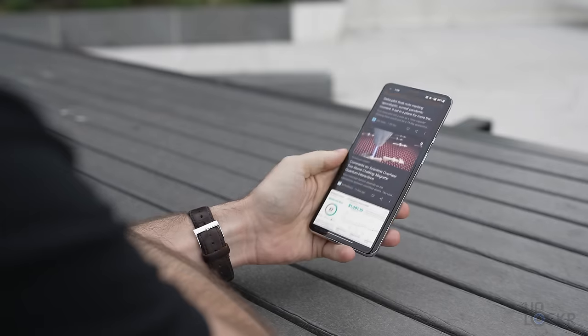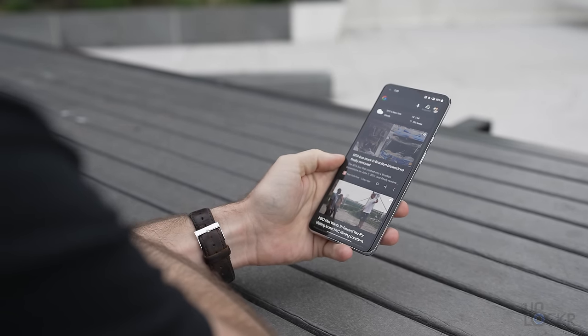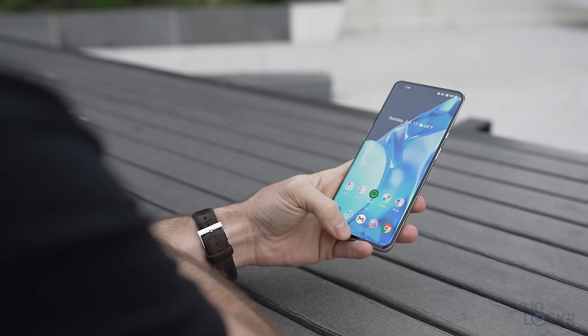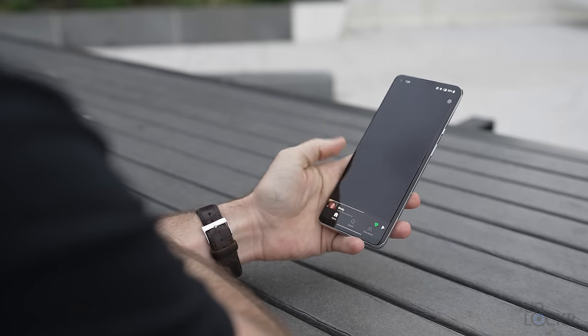But as mentioned earlier, it's not without some downside. Every time a screen is lit up, it's consuming power. And higher resolution screens with more pixels to light up consume even more power. In addition to that, every time you have to change the image on the screen, that also requires some power. So the higher the refresh rate, the more power is being used, as it needs to update a lot more often — in the case of 120 versus 60Hz, twice as often.